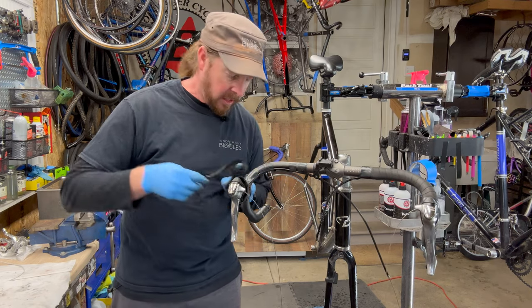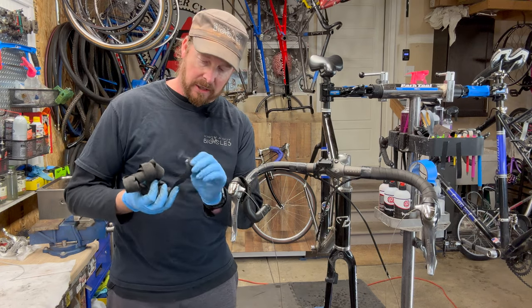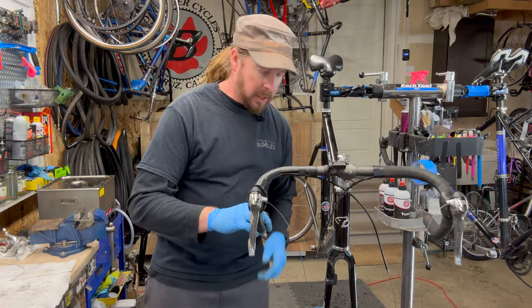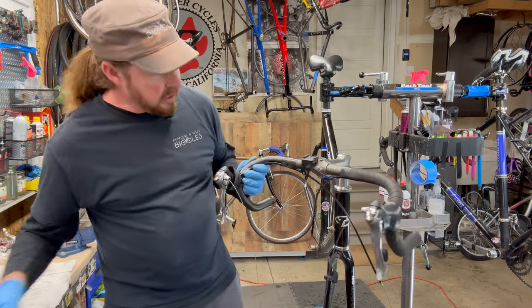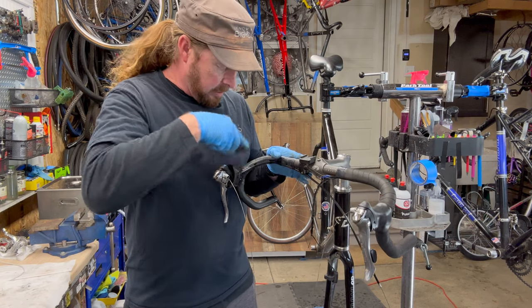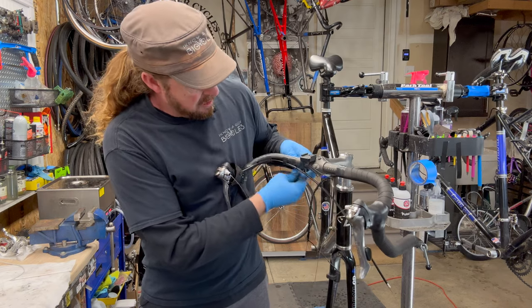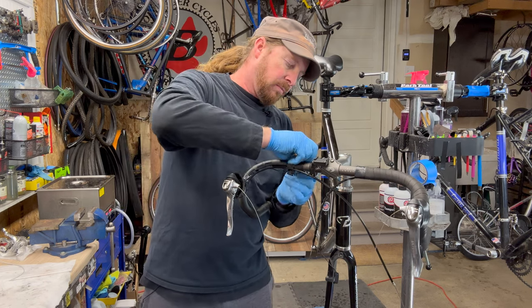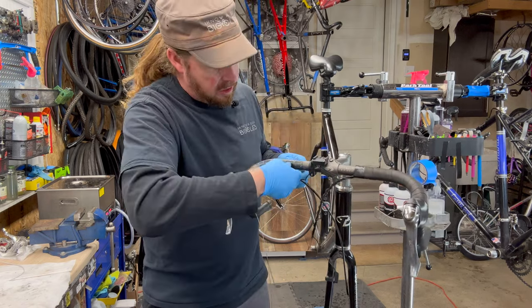That's actually stock. This is the original bar tape, or whoever taped on it, because they used to do that little tape trick on the original ones. This has a Bontrager plug. Yeah, take that off. So now we got to get this little guy free. And so I'm going to cut above the housing where the cable is not following the line, and use the housing to kind of guide my release. And there's usually extra cable from the computer that you just saw that gets tucked in underneath.